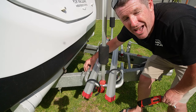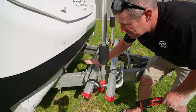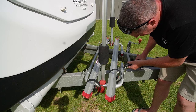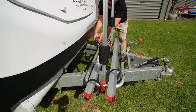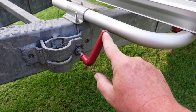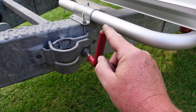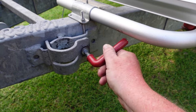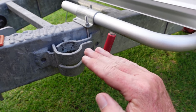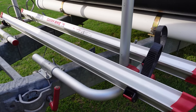Do these up so they're just not quite tight, so you can make fine-tuning adjustments. Measure front to back and centre to centre to make sure it's all in the right position, then button it all back down. One thing you do need to do when fitting these racks is shorten the lever used to operate your jockey wheel — I just cut it off and rounded it slightly, though I probably need to take a little bit more off.